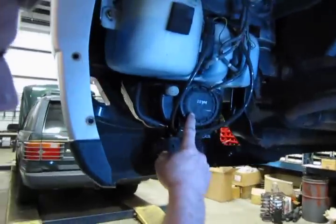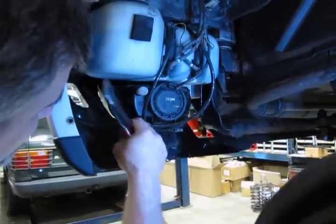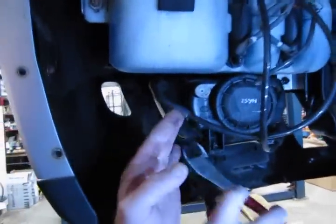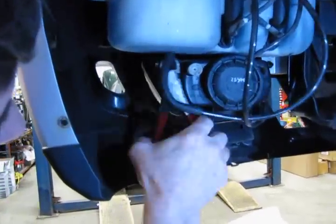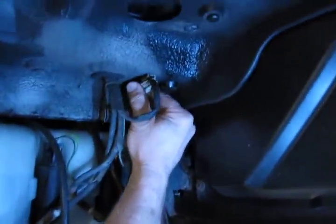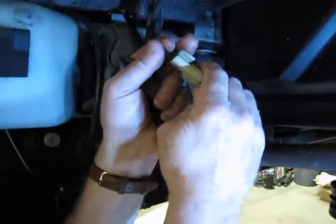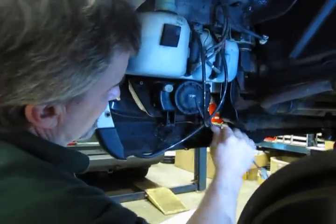This vehicle is equipped with fog lights. There's a wire tie locking in the vent for the fog light and the delivery line for the washers — we're going to snip that off and get it out of the way. We're going to disconnect this line and show you what to do with it after we get the new bumper in place. For the electrical connector for the fog light, follow the wire up to the white connector in the upper fender. There's a little white tab you lift up and slide out, then depress the tab to pull the electrical connection. Pull that down through so it doesn't get caught while we're lifting the bumper off.